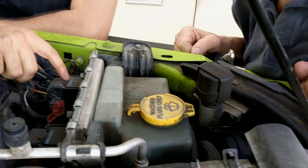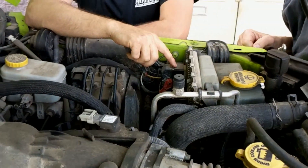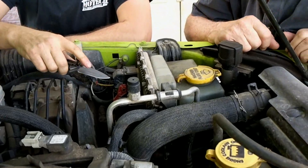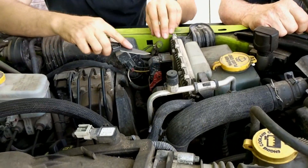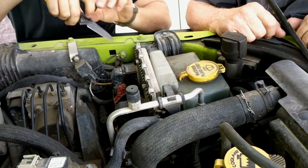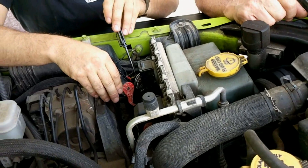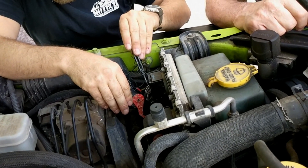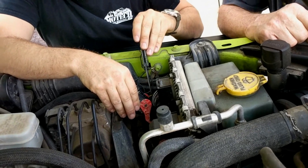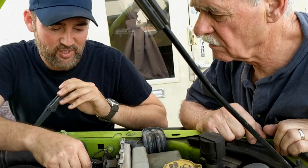The only wire you have to tap is the ignition source, and this is the easiest one to get. This comes off and you get to your wire. We've got instructions on how to do it. Your pink wire is the very last one on the bottom here — it's pink and gray. You pull some insulation off of it and you do solder the ignition wire. That's pretty much it.